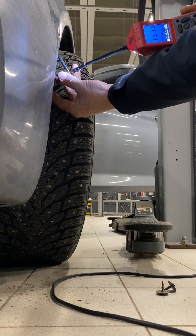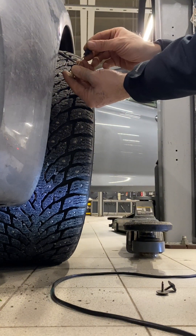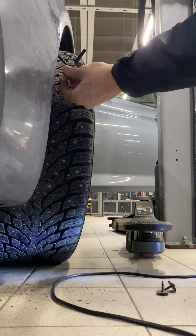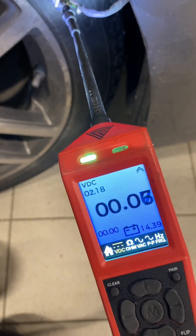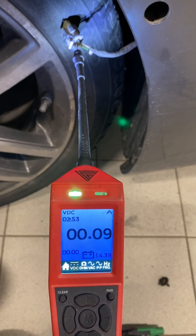What about the signal wire? It's moaning about that - the middle one. We've got 12 volts, which is a bit higher than the other side which was 10 volts. We need to disconnect this and see, because with the sensor unplugged we now just have a bare wire. We've got zero volts on there. Now compare that with the other side disconnected - it's not zero volts, there's nothing at all, no ground on it, and that's the problem. It's open - basically infinite resistance. That's your smoking gun. We have a ground on the middle signal wire when disconnected on the left, but nothing on the other side. The wire's broken, it's as simple as that.